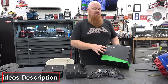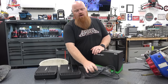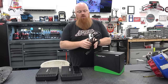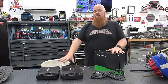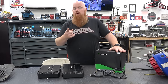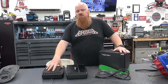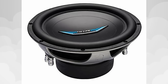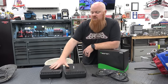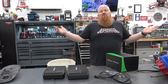We have a 10-inch Android tablet with wireless CarPlay. I'm going to mount this in the back of my toolbox and power it off a power inverter — this is a 12-volt, 30-amp one. I'm not going to run any speakers off the head unit; I'm going to amplify everything. We have a Punch one-channel 500-watt and a Punch two-channel 500-watt. We'll power Bose speakers with the two-channel, and Image Dynamics 10-inch subs with the one-channel, using 100-amp power supplies for each amp and a 10-amp supply for the radio.